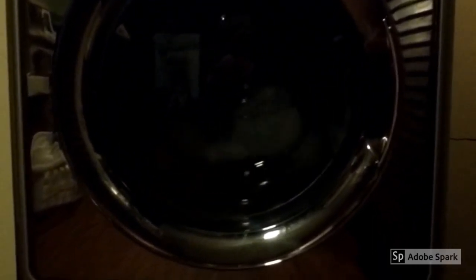We did find that the dryer does put off a bit more heat than a typical dryer, though it's not quite as bad as you might have if you were venting a traditional dryer into the room. It doesn't have any problems with putting out humidity because it extracts the water and pumps that out through the drain. In the wintertime, you'll probably like that it generates a little extra heat. In the summertime, it might compete with your air conditioner a little bit, so it's another reason we decided to do our laundry overnight where it's cooler.